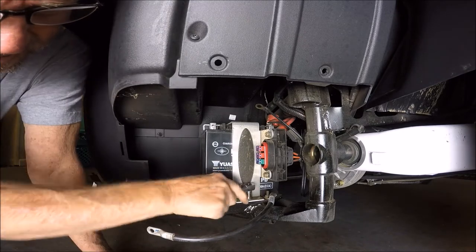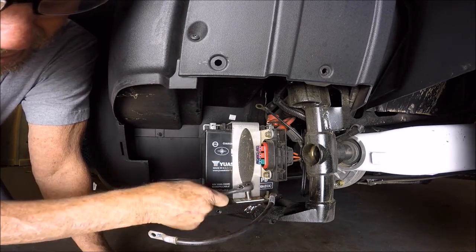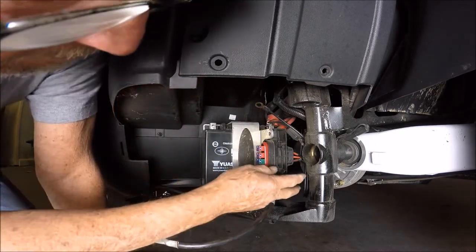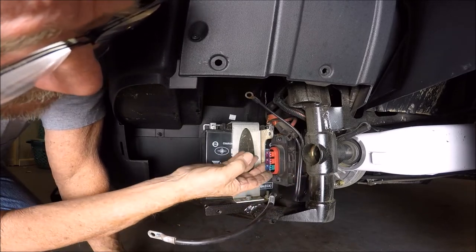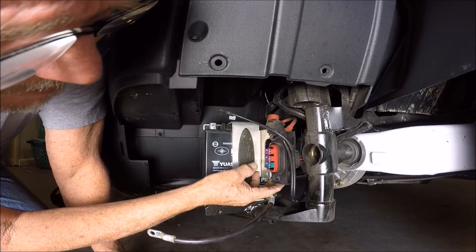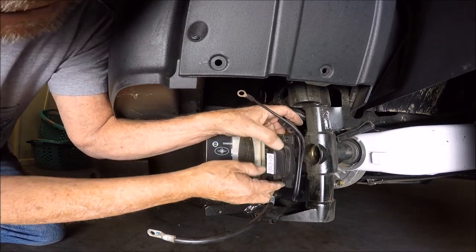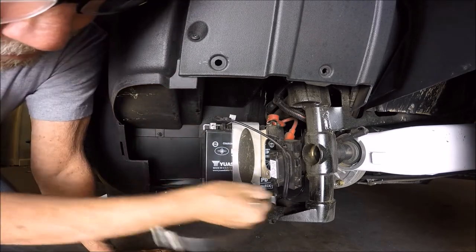All of these are 10 millimeter. You don't need to take this one all the way loose — you can leave it, because there's a cutout on the new battery tray. As we remove the last bolt holding the power fuse holder in place, it will be able to be removed. You won't do a lot with it other than have it out of the way. Now would be a good time to protect those fuses from damage by putting the cover back on — just squeeze it in place and put it to the side.